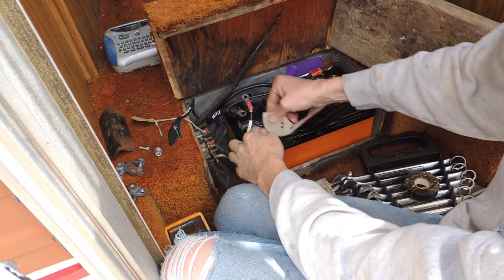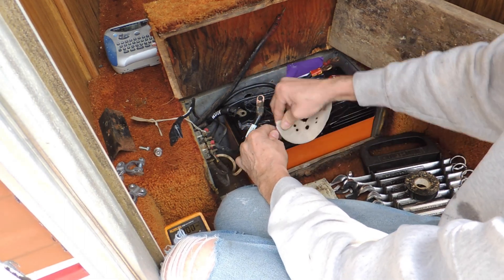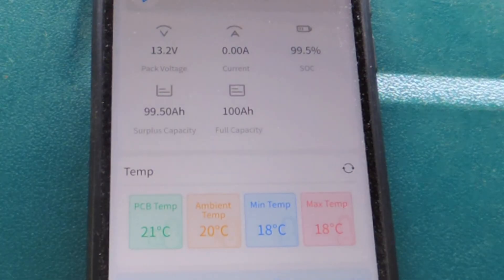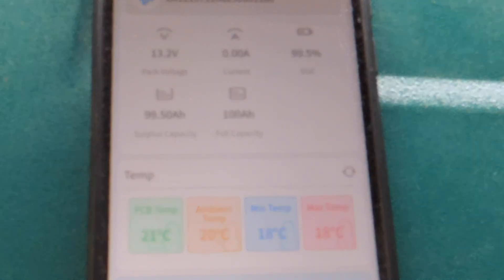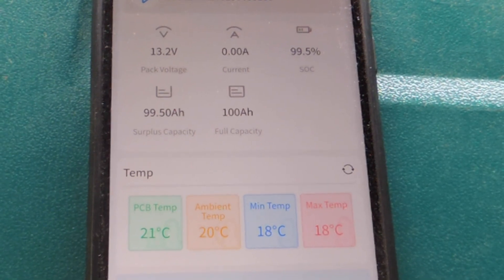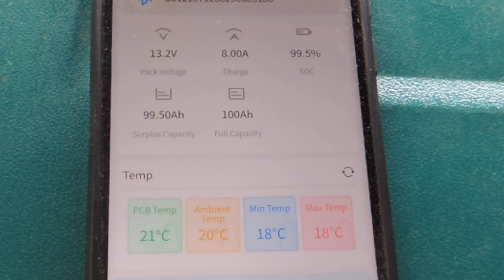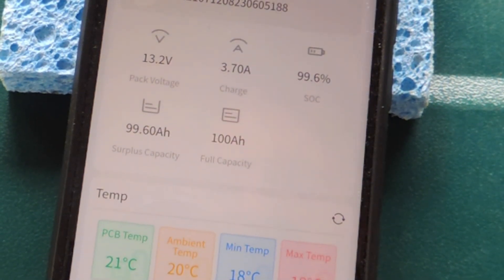It fits! It's not easy doing this around the camera. I'm going to turn on the converter next and see what happens. The RV converter is on — it's going to 3.7 amps. Now it's pulling... it just went to 8 and pulled back down to 3.7 just as my hand went in front of it.